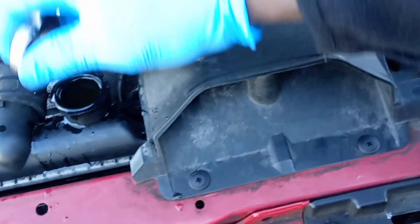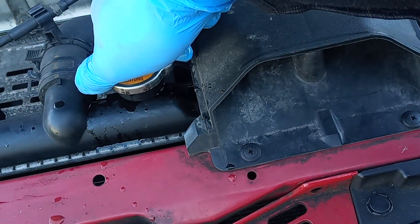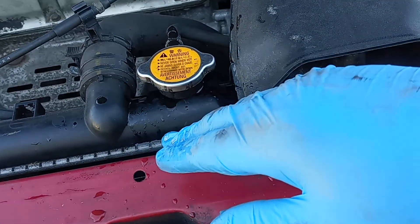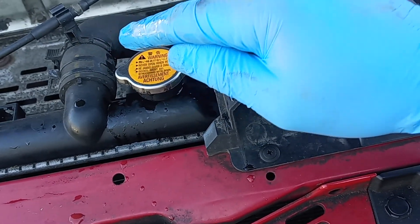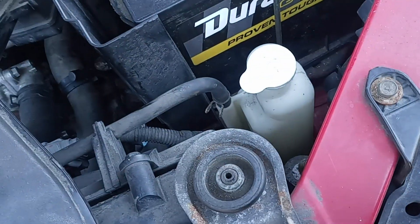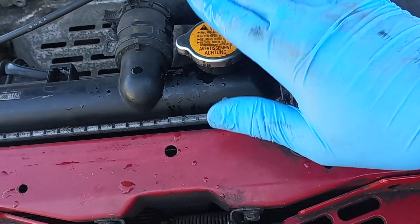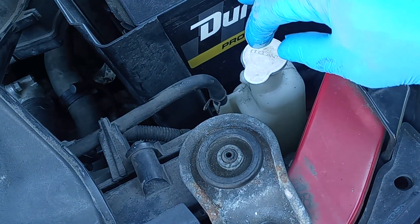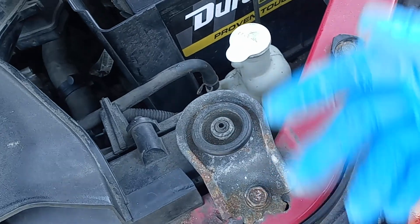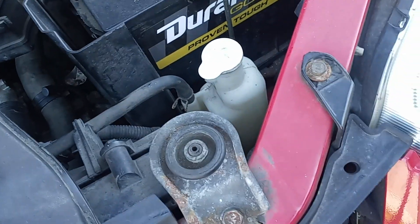That's basically it. Put the cover back on. Once you turn on the vehicle, run it for about one minute, then open it back and check to make sure it didn't suck all the way down, because running the engine circulates the coolant and you may need to top it off. The good thing is, if the radiator needs more, it will suck coolant from the reservoir. So the most important thing is to remember to put antifreeze in your reservoir. Thank you, and hopefully you learned something. Hit the bell for notifications or press like for more videos.